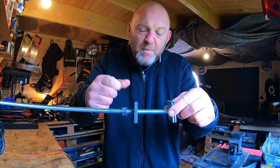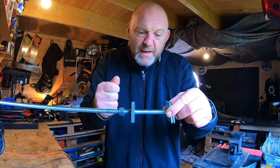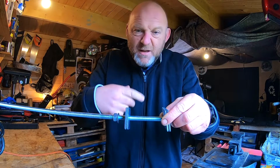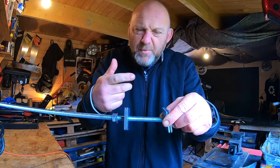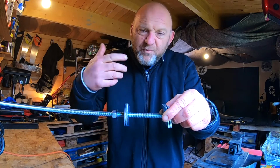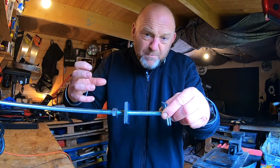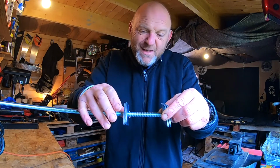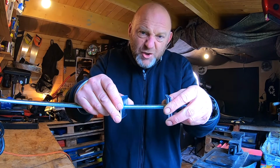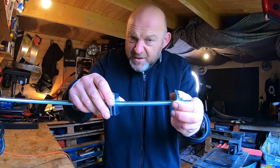You could heat it up, maybe put the bearing into a fridge or freezer, but heat up the receiver. Make sure it's all clean inside, polished up, or not necessarily deburred, but cleaned up of the rust or the crud that's inside it, so you're giving yourself the best possible chance to get this pressure fit in. That's why having something like this, a cheap alternative, can work, but it's hard work as well.